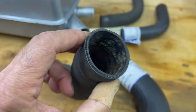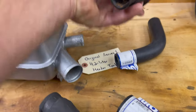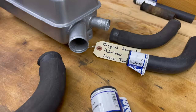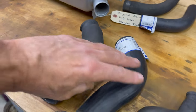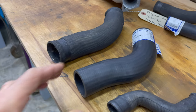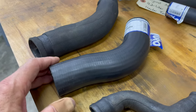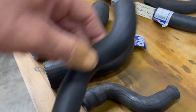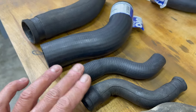This one always had a little wrinkle but now it's got a big bubble - the wrapping has separated from the rubber. I tried cleaning them out, but there's a lot of coagulated rust in there and they're pretty stiff. I decided to set those aside and keep them for posterity, but for the sake of getting it running we're going with new hoses. I bought a set of new basic fiberglass-reinforced hoses. I like how they have a little ribbing and texture similar to the originals, though this one is formed with a fat spot for the thermostat housing.